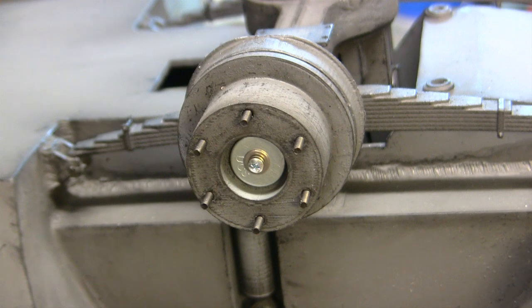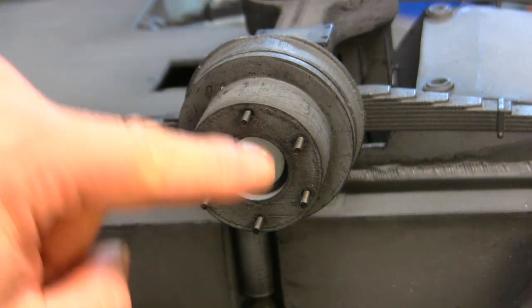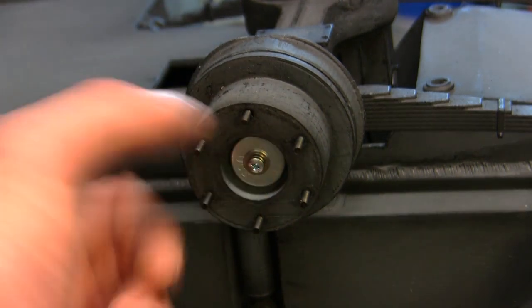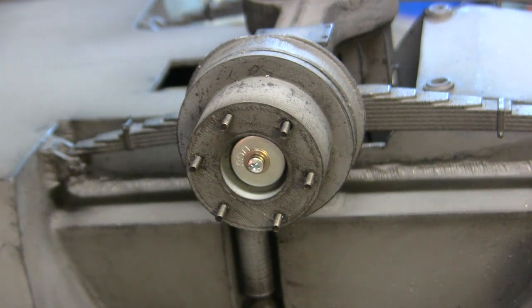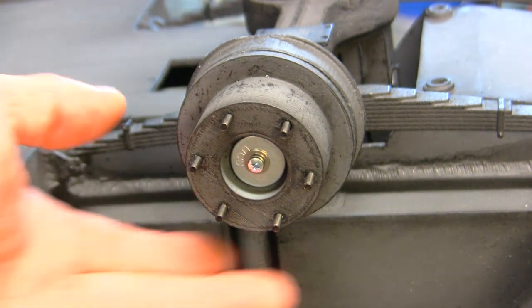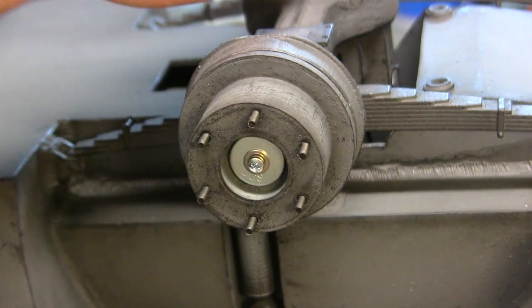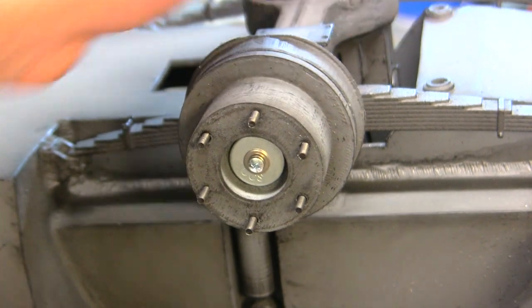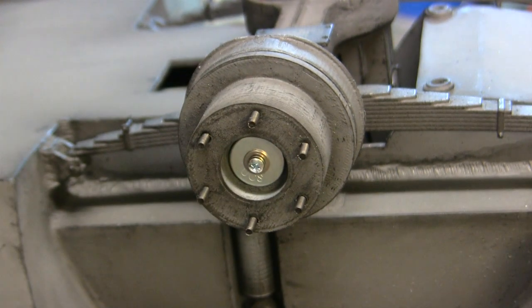It's far too easy to tighten to the point where the rims and the washers will actually stick to the fastener, and if you're rotating it, the fastener can turn on you. If it turns, this is bad news, because if you move in one direction, it's actually going to tighten the unit more towards the differential, which will eventually bottom out and even strip. Or if it goes in the other direction, it's just going to unthread itself and the unit will fall apart.